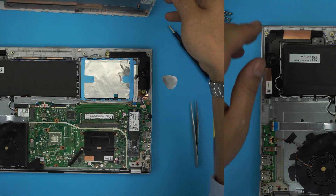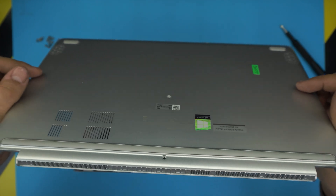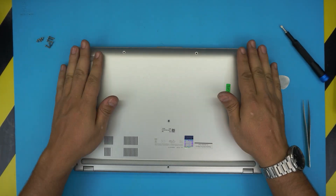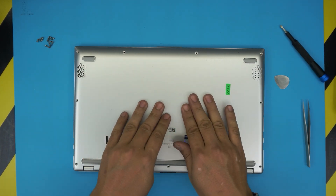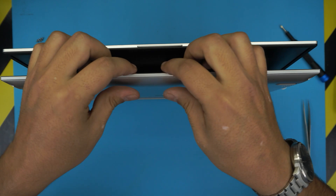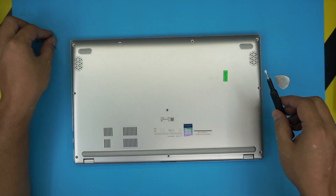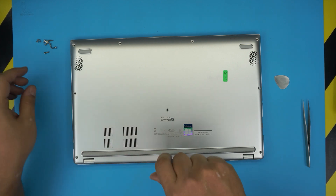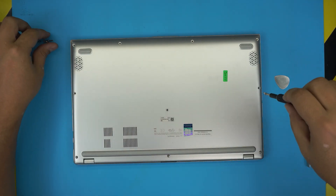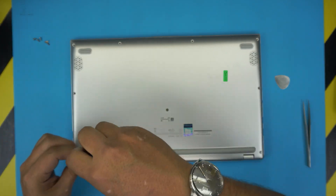That's how you replace the battery. Grab the bottom cover, bring it over, align it, and press the corners until they click. Work your way from the front end to the back side. Push in the side by the battery — there's one clip there. If you see any gap at the front, pinch between the top and bottom cover firmly and it will go into place. For the screws: the longest screw goes at the back middle, the medium screws go at the corners, sides, and center, and the short screws go at the front. I hope this video helps you out!